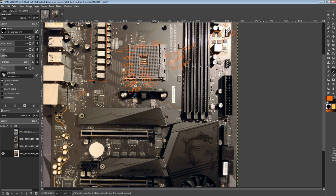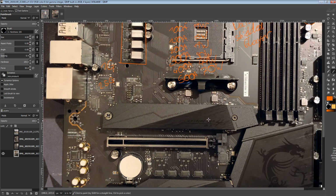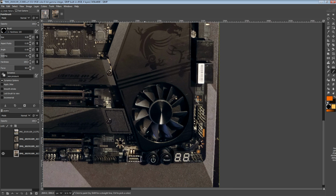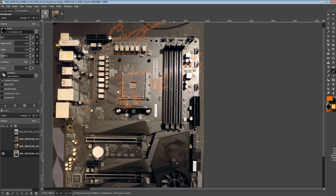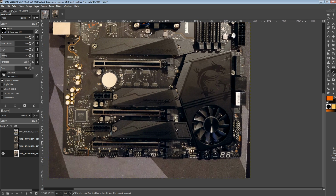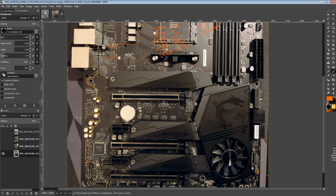The Ace is this, but with 1 gig Intel extra, and the postcode put in a worse location. The postcode ends up here instead of where it is. So the Ace is, in some ways, a worse board than this, except that it adds the 1 gig Intel. So that's kind of my thoughts on the Unify: this is a really, really great board. The Ace adds things like RGB, which is a waste of board space, and a game boost knob, which is a bunch of automatic overclocking profiles that I recommend you never use.